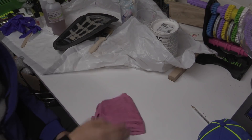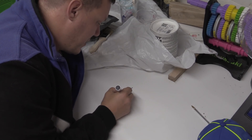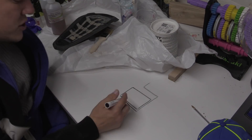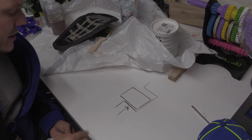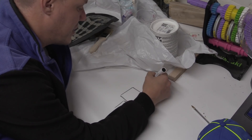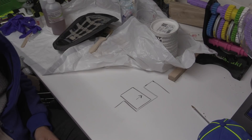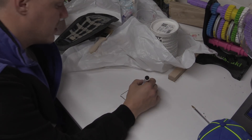So you'll have a piston ring like this, and the piston's on its way up. Because your groove is wider than your ring, the ring is shoved across the bottom - the piston is basically carrying the ring with it. When you get to the top of your stroke, the piston abruptly stops, and the ring continues to move because of inertia, and then the ring slams into the top of the piston groove.